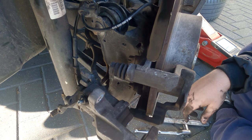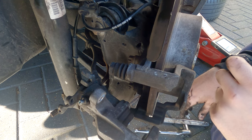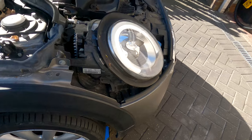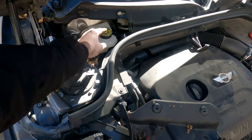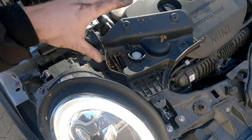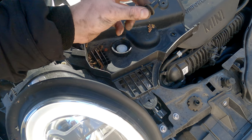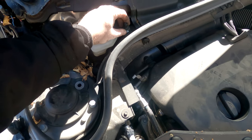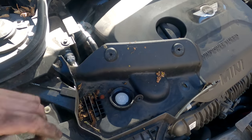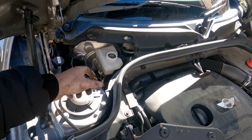Do the other side — it doesn't actually have a brake wear sensor so that's nice and easy there. It's not too bad of a job, not £200 worth, so let's crack on. Next on the agenda is to take the cap off the brake fluid reservoir and put that aside. This part is covered in a shroud with a couple of lock bolts and a little nut. Once that's undone, just take it off and the whole thing pops off — this just makes it easier to rewind the caliper back in.